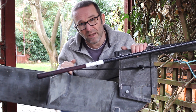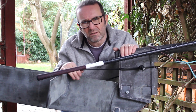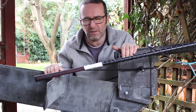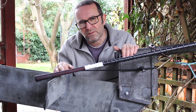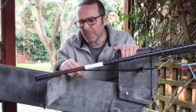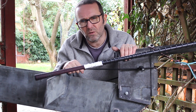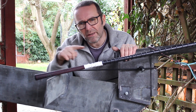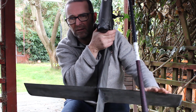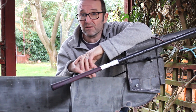I've actually made three of these in the end, over time. The first one was just made out of foam — snapped instantly. The second was made out of wood — did really well until I had a strong wind day, then one side snapped off and because it all got unstable, the other one snapped off too. This one has gone through some pretty severe conditions, to the point where it's broken a stock a couple of times and strained the back of the boat, but it's never broken. Someone on the National 12 forum told me: if you're not prepared to use this as a step to climb back in the boat, it won't be strong enough. So that was my point of testing — I stood on this before it was in the boat, used it as a ladder, stood on the end, didn't break, and they still haven't broke, and it's still working fine.